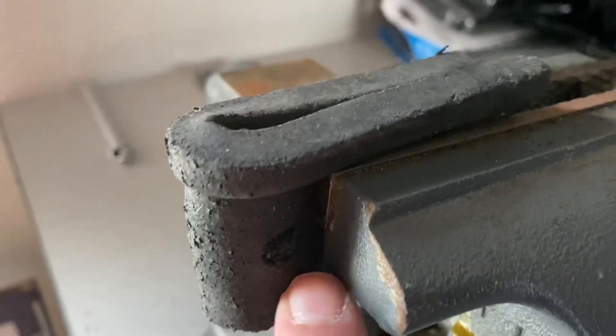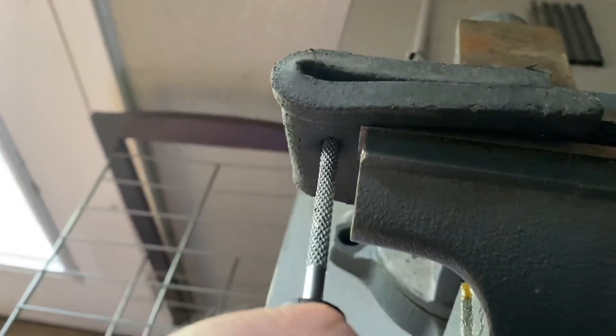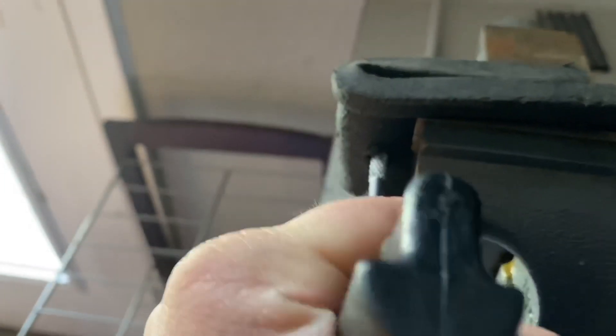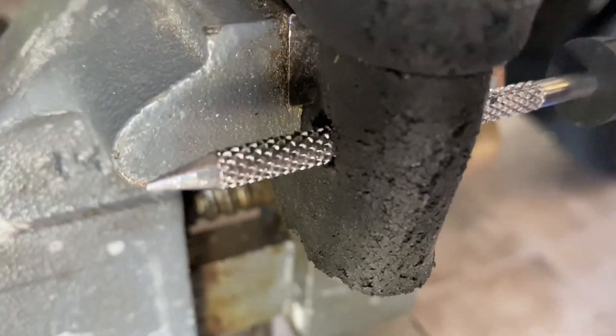Up here is going to represent our hole in the tire. In your little tire kit, you're going to use this — it's a reamer — and you're basically going to file out the hole back and forth numerous times to get a nice clean hole, just like that. So you're just running this back and forth in the tire to get a nice clean hole.